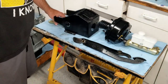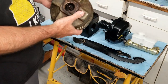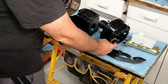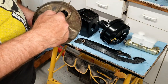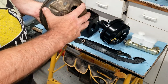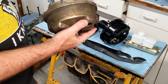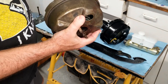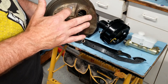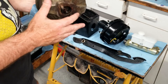There are a couple of reasons why we replace some of the parts. First off, this servo right here - here's the old servo. This is where it connects to the intake manifold, so it draws vacuum pressure. The back side of this diaphragm is in a vacuum, and then the front side uses atmospheric pressure to push the brakes when you apply them. It's the variance between the vacuum pressure from the intake manifold and the atmospheric pressure coming in from this side that gives you the brake assist.